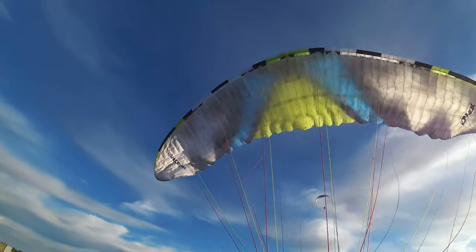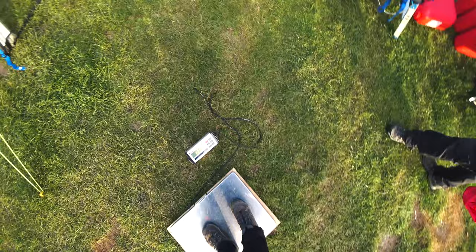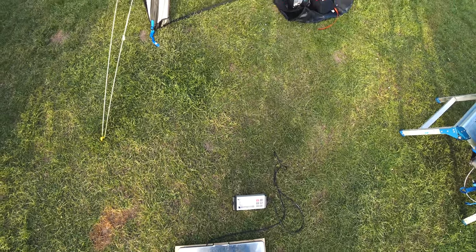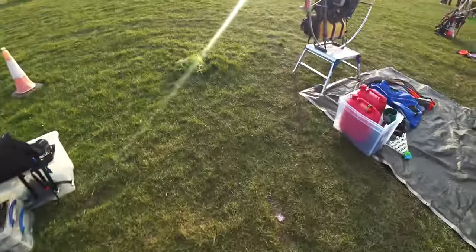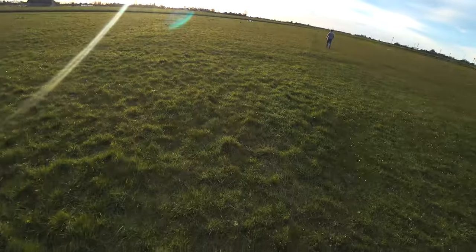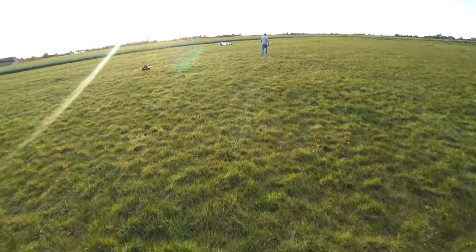To make this accurate and give ourselves fuel burn after this flight, we're going to weigh the motor. Pilot weight, motor, and five litres of fuel in, and we are looking at 93.3 kilograms. We'll weigh ourselves when we come back in, record the time, and do the calculation for fuel burn. The wind at the moment is nine gusting twelve, so easily launchable.